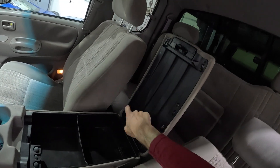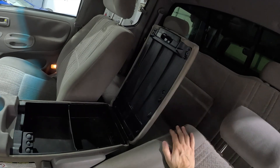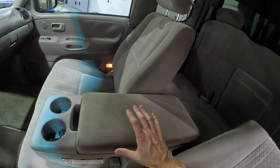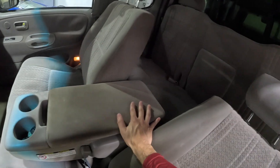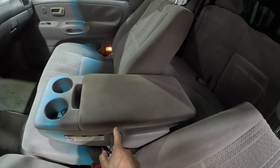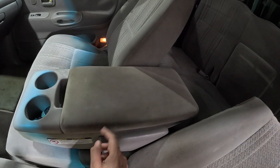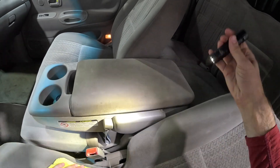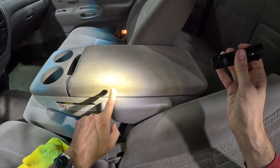You've got a plastic panel on here with six, seven, eight screws. Toyotas are pretty straightforward — there's no downside to unbolting this and recovering it. If you want to use a fabric adhesive and come in and recover it — this is not fixable, right? There's no fiber left on that at all.